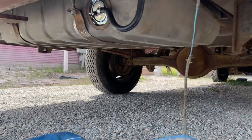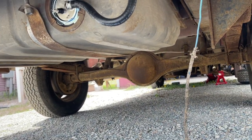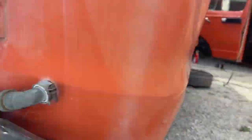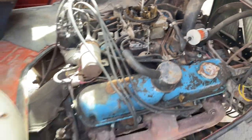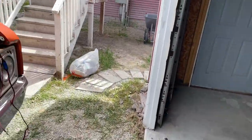I skipped some steps — I've been working on this because I just wanted to hear this thing run. I got the gas tank back up there in a temporary fashion. I've replaced the sending unit and drain straw. I did have to replace the fuel pump — super easy, I jacked it up and replaced it right there. Got a fuel filter too. We were having a heck of a time getting it primed. Finally, I read a YouTube comment that just said keep trying, so I tried.